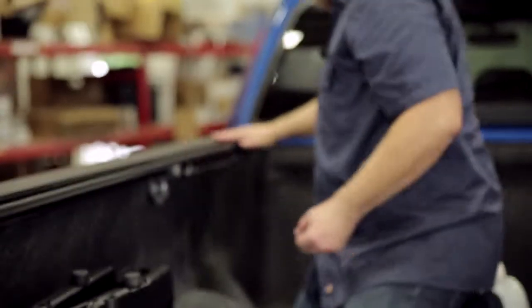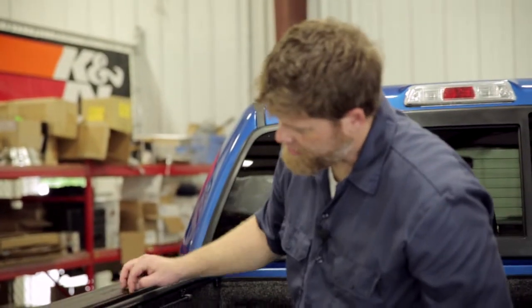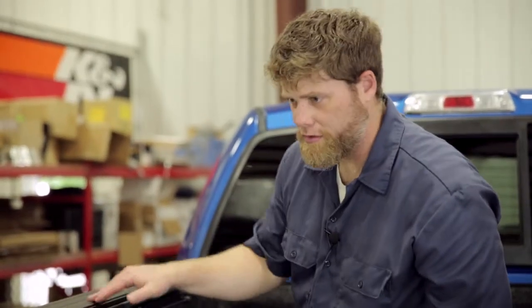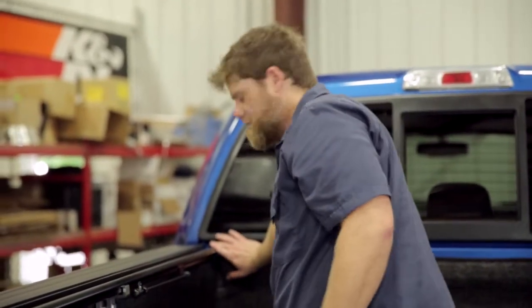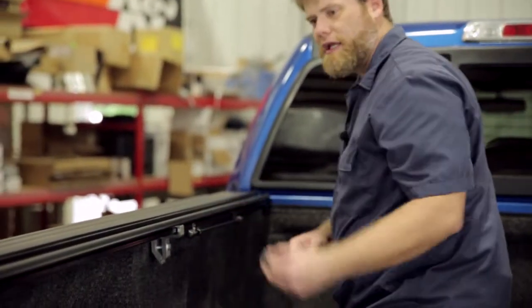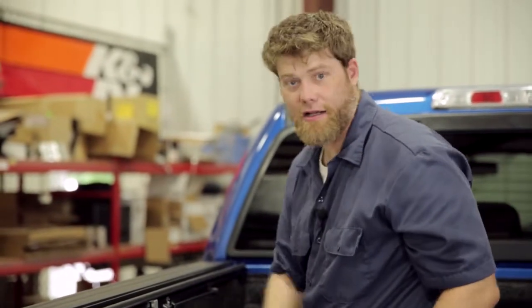So now that I've got the middle on, they say in the instructions the mounting rail needs to be about an 1/8 inch below the rail itself. So we check that, make sure it's flush against the bulkhead side, and we'll put the other clamps on, do the other side, put the tonneau on, make all of our adjustments, then come back in and lock all these down.